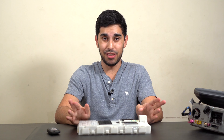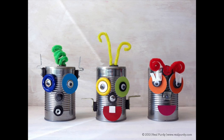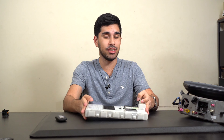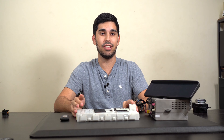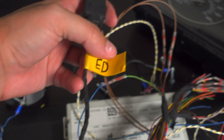Bingo — back to the hell box. There are probably over 200 wires to get messed up. This computer checks what's going on with the start button and then communicates that onto K-CAN. But the reason this is important is it's not going to unlock anything until it knows the key is present, because it has an immobilizer. So before I can even think about turning on the head unit, the giant white rectangle of pain needs to know if the key is present, so I added a key sensor.